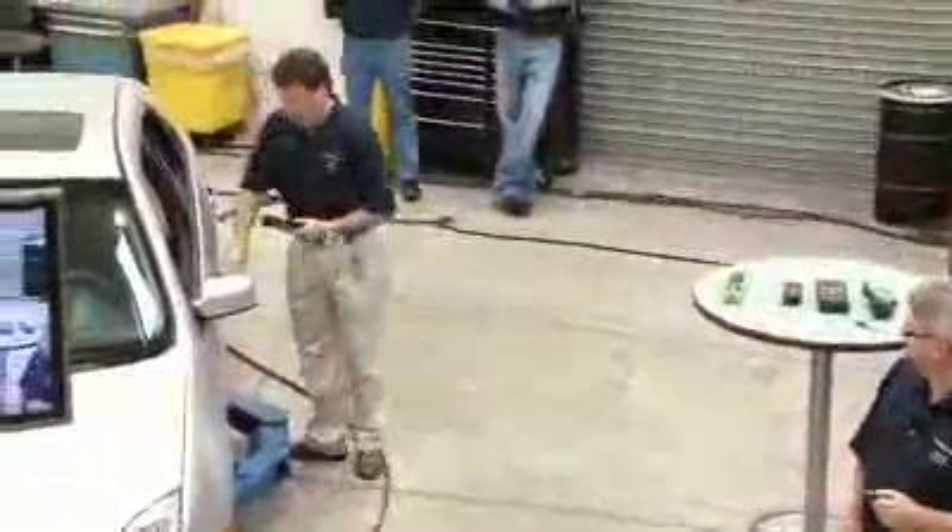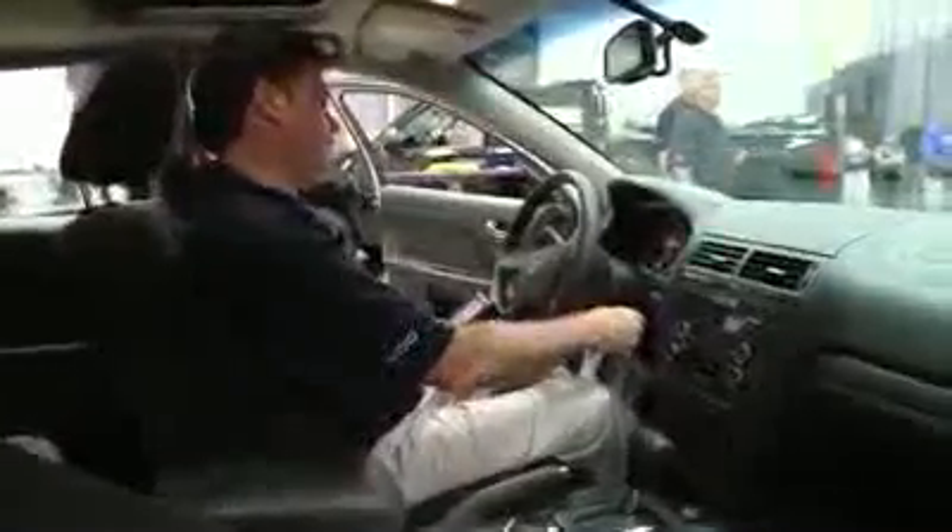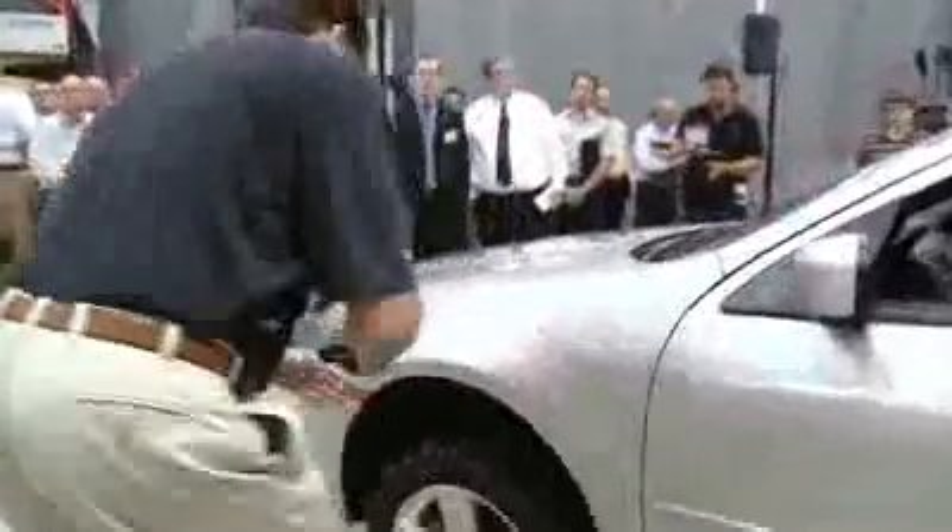John Kristoff is going to put the vehicle into relearn mode. On a Ford, it's a sequence of key on, key off, press the brake, and then key on, key off — symbolized by a horn honk. And now he will go around and just make sure the vehicle has learned with these OE sensors.